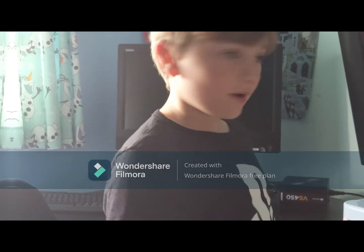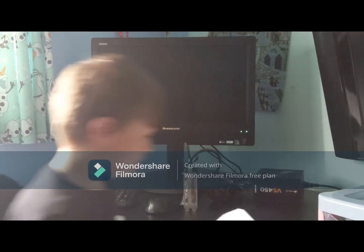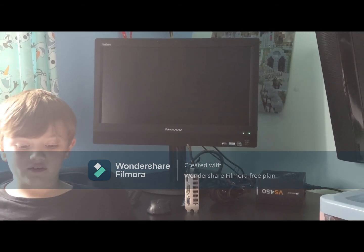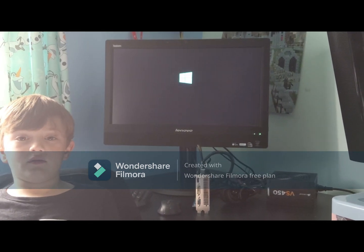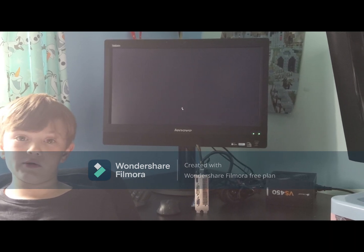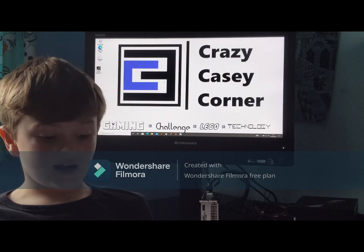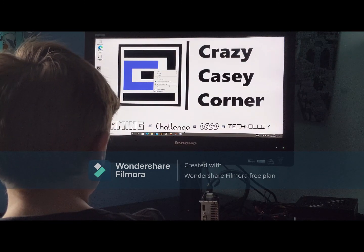Now to turn everything back on. It may take some time, but Windows will still detect and try to install drivers for the GPU. However, we can also visit the official NVIDIA website and download the most up-to-date drivers, as well as the additional software to go with it. We've downloaded and installed the driver and done a restart. Now to change a couple of settings, right-click NVIDIA control panel.